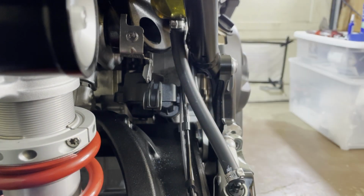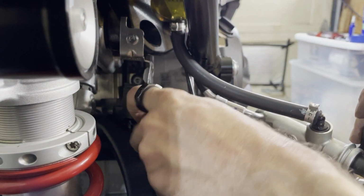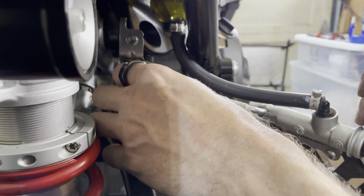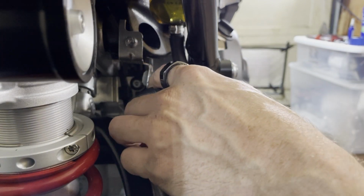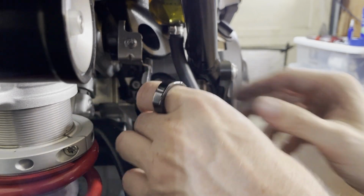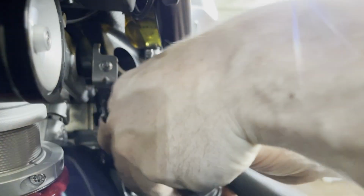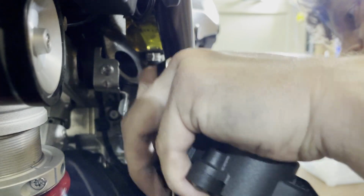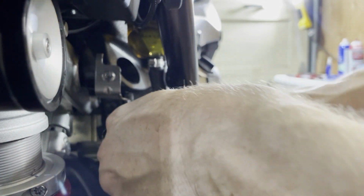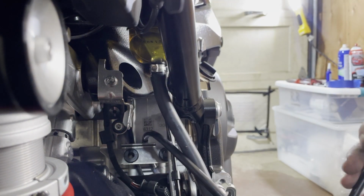So I took out this screw. Now this, pardon my reach, should just come out, and it does. Now this is of course electronically connected, so there will be a cable. So don't just pull it out like a maniac. We have to disconnect this cable here first. Now I can finally see, so you have to get under that clip, lift that up, and free it comes. And I'm just feeding on the other side, one cable at a time. It's actually a pretty tight fit. And so many things that get stuck. So don't yank it. Cable number 1 is free.